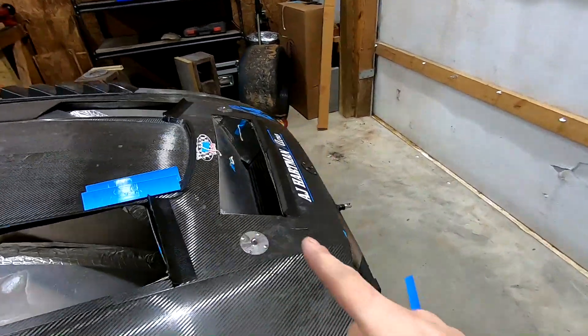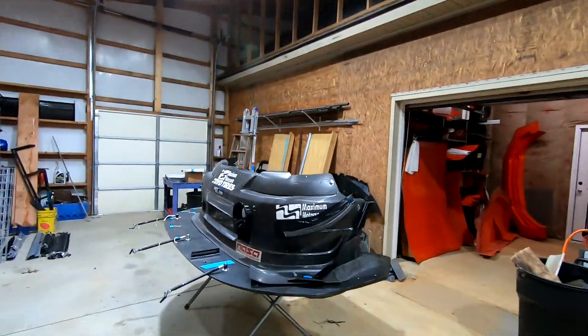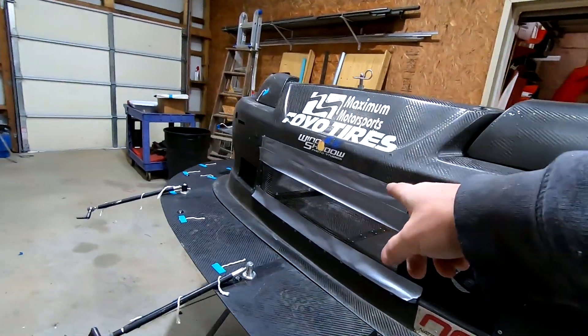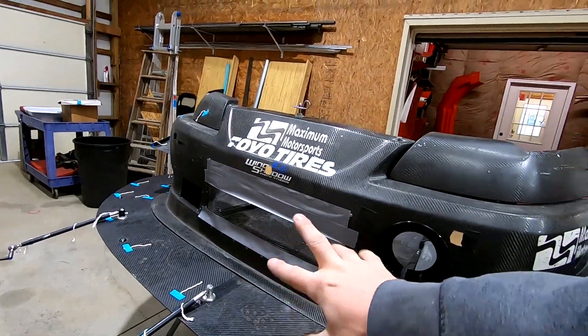I did a video on how I made these — I'll put a tag up here. Going from no gurney to gurneys picked up about 14 or 15 pounds of downforce, plus much better pressure drop across the radiator. We had probes in front of and behind the radiator, so not only are you picking up a little downforce, you're picking up better cooling. If you end up with too much cooling you can always tape up the grille, which is kind of one of the last runs we did at the wind tunnel.